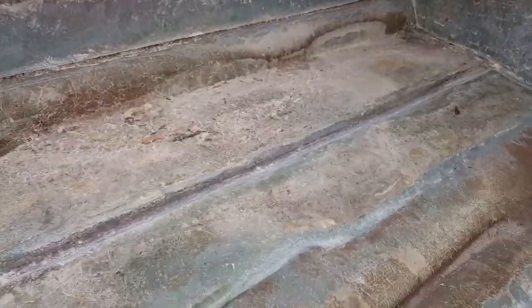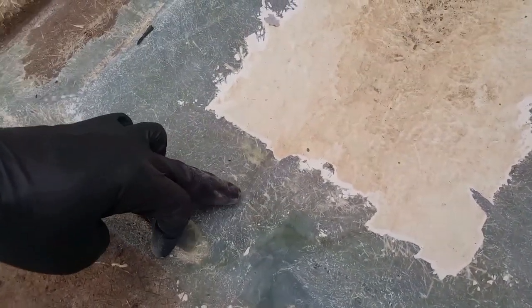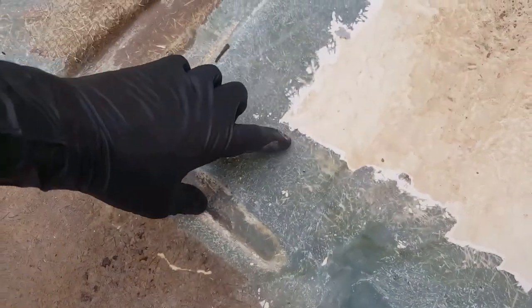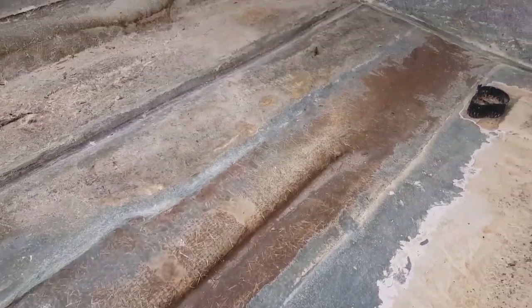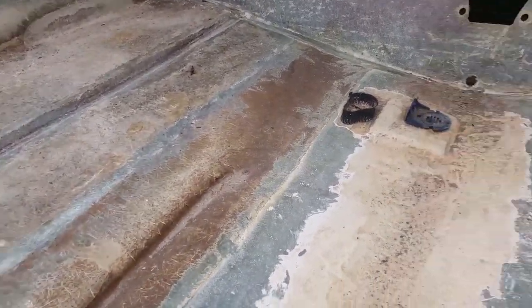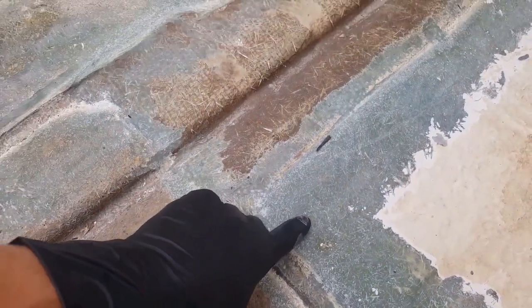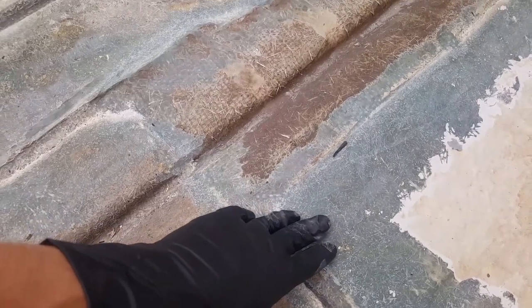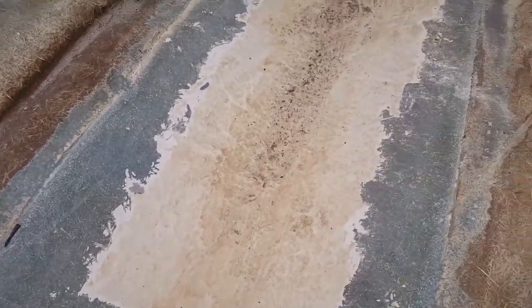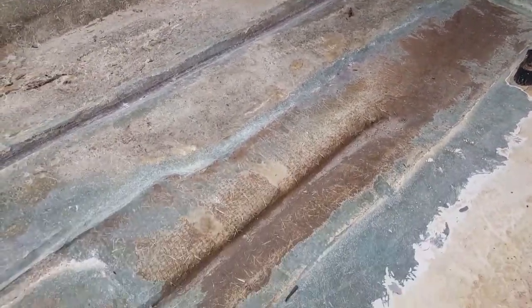The other piece I'd like to tell you about is, so this is the bulkhead. You notice where I took out about 3 inches. I talked about this in my prior video. On a prior boat build, what I actually did was, you can see the dark spots here where the foam was, I sanded the entire thing down. Left, right, all the way to the front. The boat on the bottom looked like this from front to back. The problem with doing that is, number one, it's a lot of work, and the second piece is it's completely unnecessary. So as you're undertaking the same exact process yourself and trying to figure out how much to grind in here, keep that into consideration.